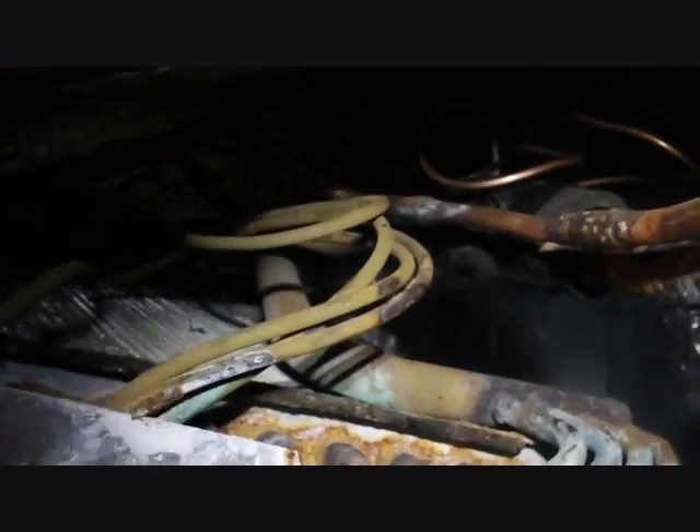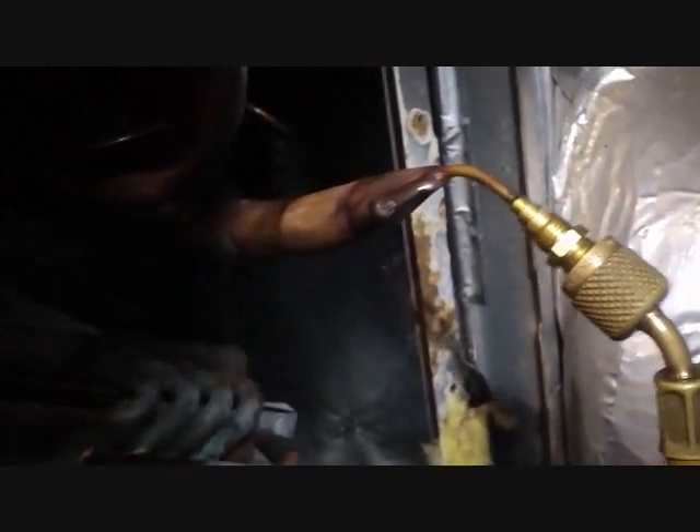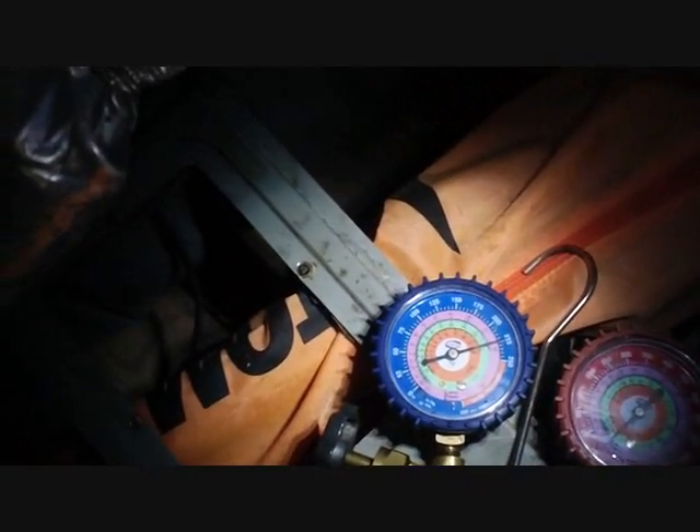I had a leak on the bottom of the TXV fitting that I brazed in — real hard to see. I worked through that one, got out the devil horns, and took care of it. But there was another leak that was really bothering me — right where the TXV and the check valve tube meet, before the capillary tubes. It actually had a factory leak, believe it or not. So we kind of did some good here even though we didn't intend to. Had to repair that leak and now we have 225 pounds of pressure.